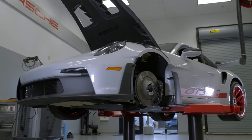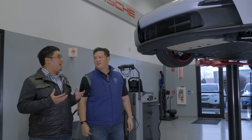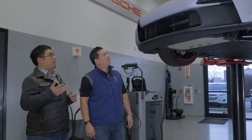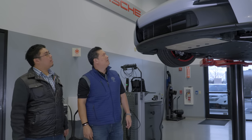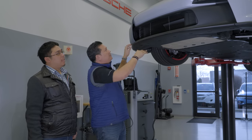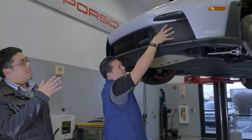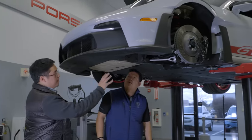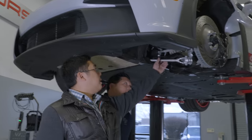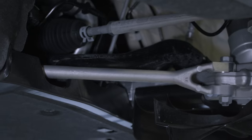So let's look underneath — starting from the very front and working our way back. Immediately at this height I'm noticing these little tension cables here. We create so much downforce on the front with the front splitter. Just like the last GT2 RS, we have a few more reinforcement pieces. This piece here is fixed — not active. We'll show you the active parts inside the front suspension later. Air goes in here for cooling, and with no side radiators, air can enter here. The suspension pieces are now wishbone-shaped, serving as reverse wings — we want downforce — and that alone already creates 88 pounds of downforce just by replacing those links from what the GT3 has.